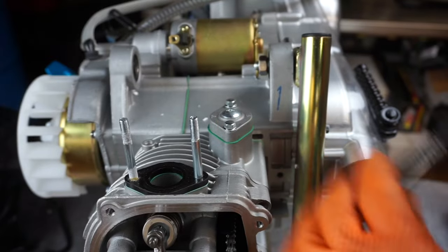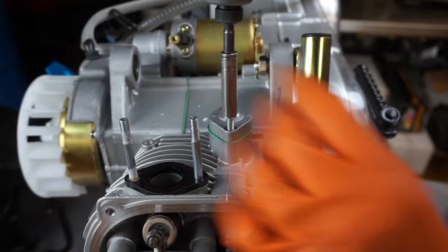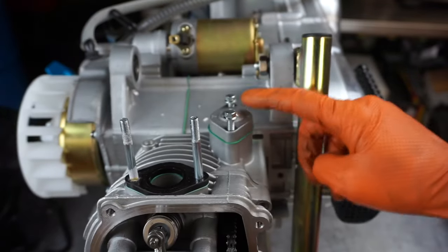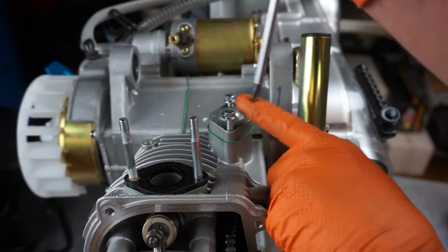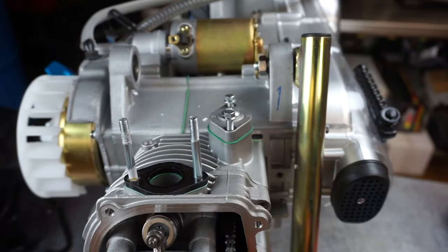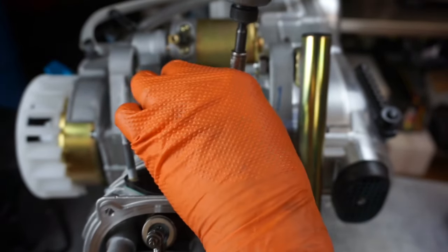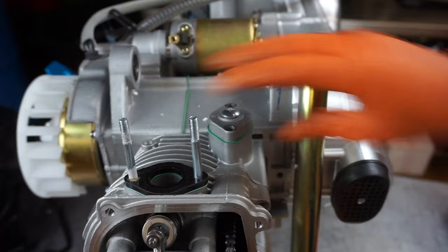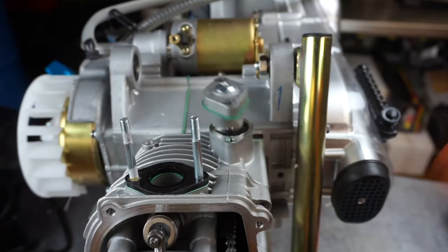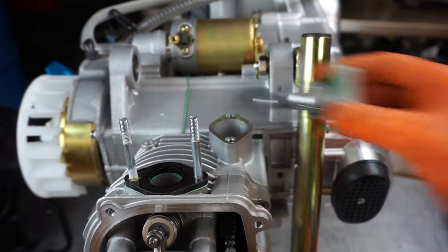At the top there are more 8mm bolts — this is your timing chain tensioner. I've got it halfway screwed in, so let's pop this loose; it's just a Phillips head, just slightly like that. Then we can remove the rest. Use the back of a screwdriver or a mallet to pop that loose. Set that aside.